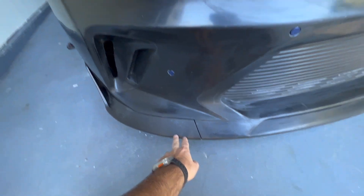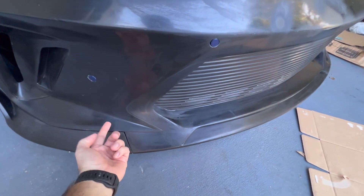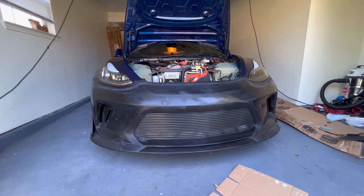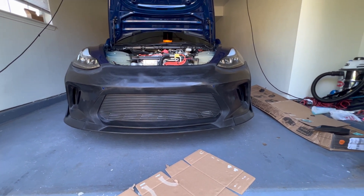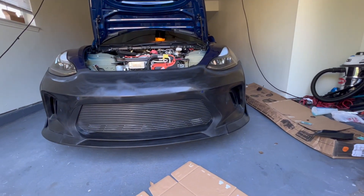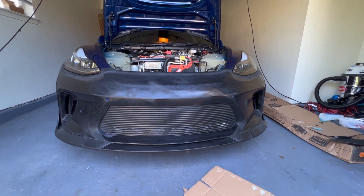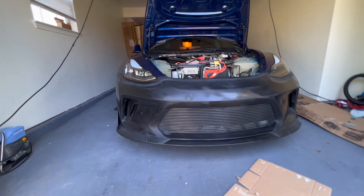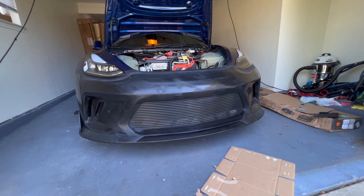The side lip on both sides is on screws and you can actually remove it, so that'll work out really well for a wrap — you can bring your wrap under there, wrap this separately, and then screw it back and secure it. That's kind of what it looks like pre-paint or pre-wrap. Before I wrap it I probably don't want to go too crazy fast so the wind doesn't blow those wheel wells out. I think it looks cooler with them but I don't want it to create any problems. That's pretty much the whole video on how to mount your Robot Craftsman Tesla Model 3 bumper. I'll do another video when I wrap it — if you have any questions post them in the comments, give me a like and a subscribe, and we'll see you on the next one.